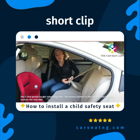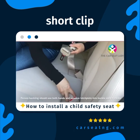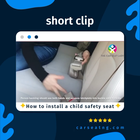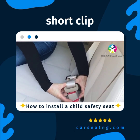One trick when it comes to buckling the seat belt back in: it's helpful to have an extra person help you. They're going to take one hand and make a number two, grab the buckle from underneath. Grab the underside of the buckle and pull it up as hard as you can, and use their thumbs on the top of the latch plate to squeeze the belt together into the buckle.